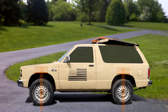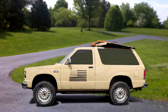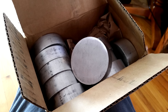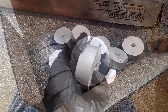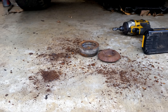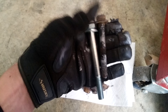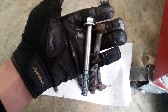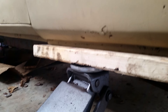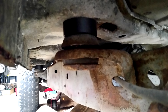How about a body lift? The only kits out there are 2-inch and 3-inch, and those are both too much — I wanted a 1-inch lift, just enough to clear this engine and maybe help clear some bigger tires in the future. I went with 3-inch aluminum from eBay — it's the cheapest and strongest way to do this. Took these solid pucks, drilled a hole in each one, gave them a quick coat of paint. By the grace of the gods, all of the body mount bolts came out okay. I got longer grade 10.9 bolts to use with the extra height. Due to some of the body panel rust, I had to resort to some interesting methods to get them all in, but everything worked out and it turned out looking pretty good.